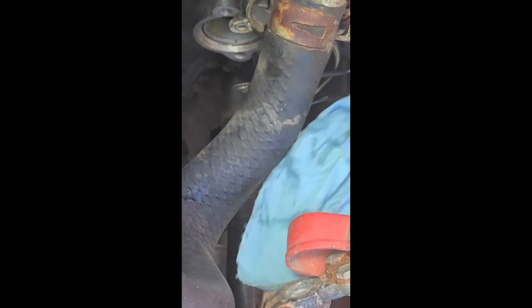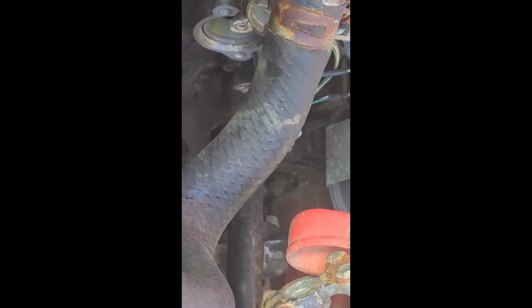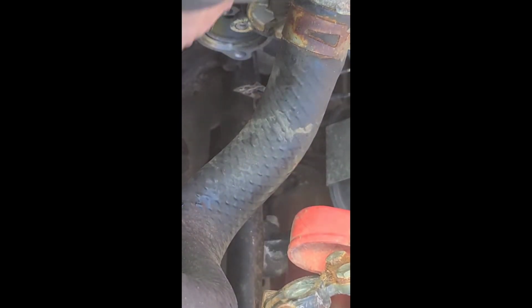I'm also gonna go ahead and, it seems like it has a leak around the whatchamacallit, oil filter. So I've always put 10W30 or 10W40 in these Geos, but this cap says 5W30. I've got some 10W30 I'm not gonna use for anything, so might as well put that in there. Come on, I don't guess I'm gonna be able to get all that fluid out of there.